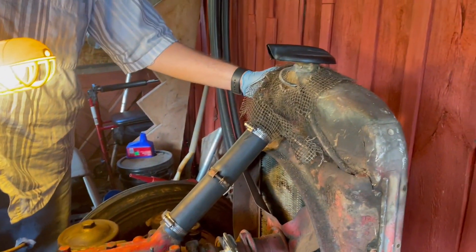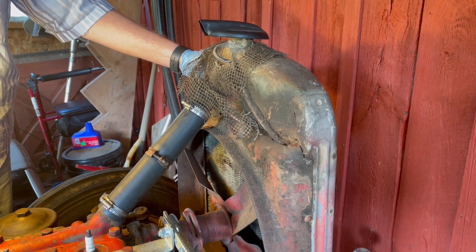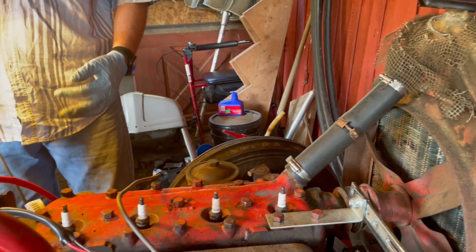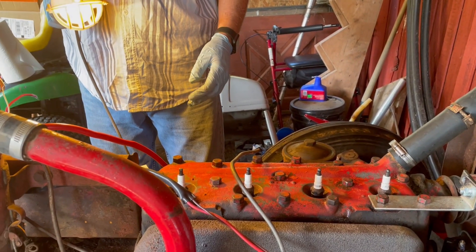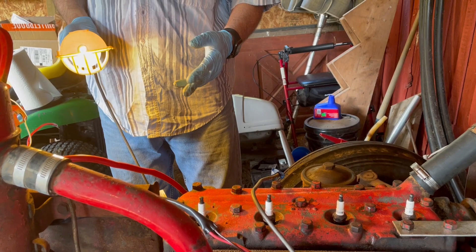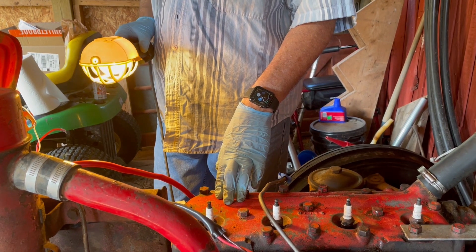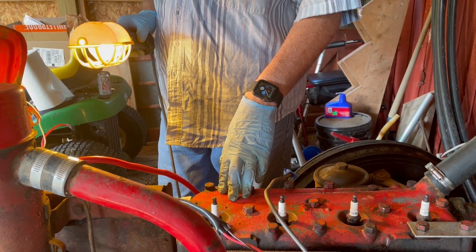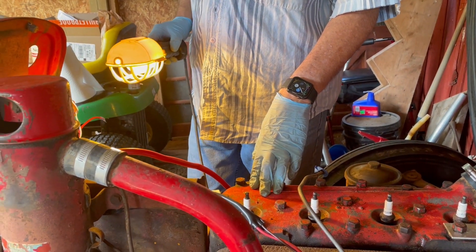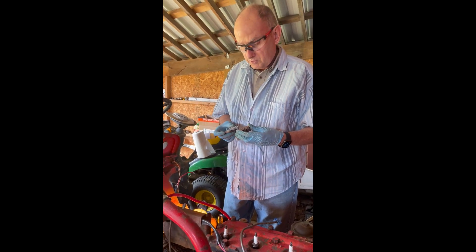The radiator is still in pretty good shape so we're just going to keep that, even though it's really rusted. It's still okay — there are no holes and it's not leaking. Also, the 6 volt system is a positive ground, where the 12 volt system is a negative ground. In a positive ground system the positive terminal of the battery is connected to the frame. On a negative ground system, which is how all cars are today, the negative terminal of the battery is connected to the frame.